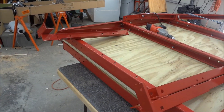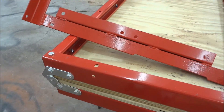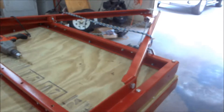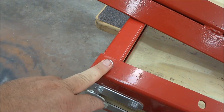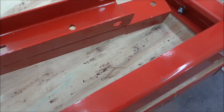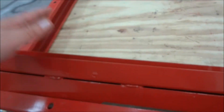I'm going to go ahead and assemble the brackets for the axle hubs and wheels right up here on the table while I've got this thing up here — it's easier to work at waist height. One thing to note when assembling this: this is the frame with the tongue on it. You're going to want to avoid installing these corner bolts early, because these corner bolts are actually part of the assembly here. I've got to remove that bolt to install this bracket, and then another bolt goes right in over there too.